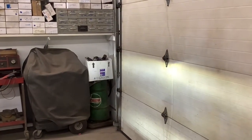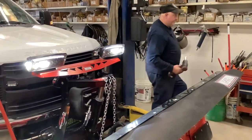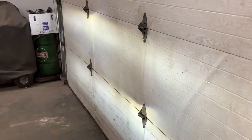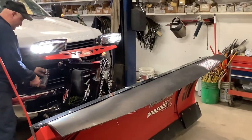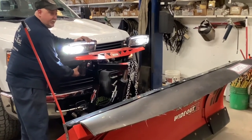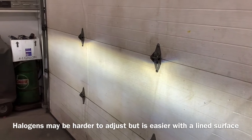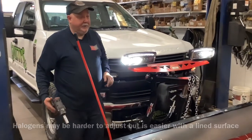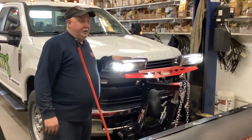Tighten your bolts up — you don't need to over tighten them. Move to the other side. These are pretty distinct markings on the light; there are lines actually on it, and you can see them fairly easily on the LEDs. The halogens are a little bit more difficult because it's a wider beam, not a straight beam like the LEDs, but it's basically the same concept. Just get them to the same on both sides, tighten them up, and you're ready to roll.